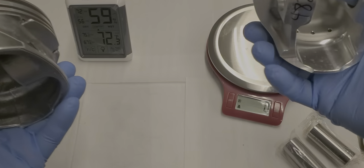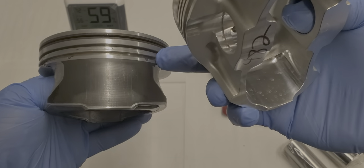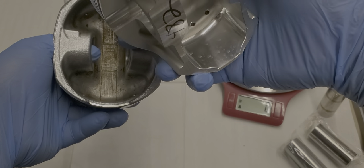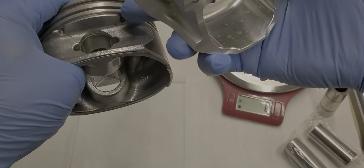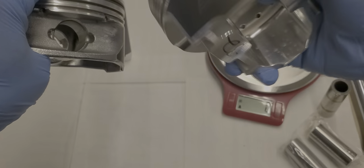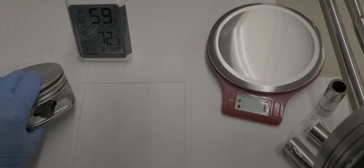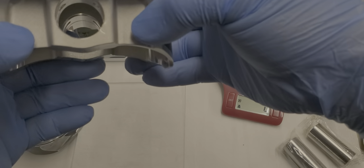One really interesting feature I thought was pretty cool — mostly because I'd never seen it before — is oil holes for the oil to push back through from the oil ring, so the wrist pin can get its lubrication. On the stock piston, it also gets lubrication through the sides, and I'm assuming it directs oil flow to a channel on the inside where oil can seep in.